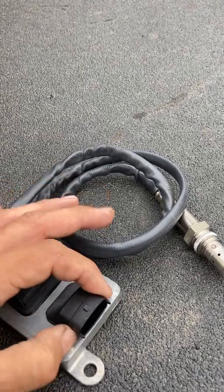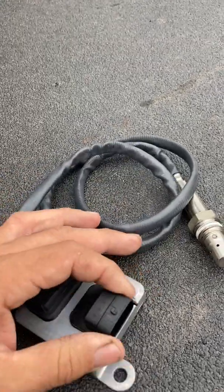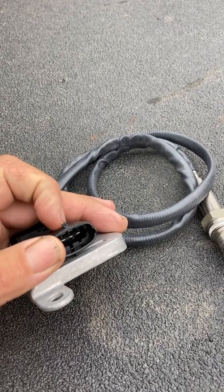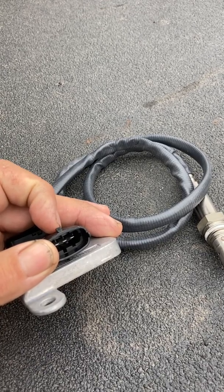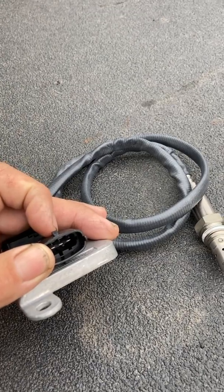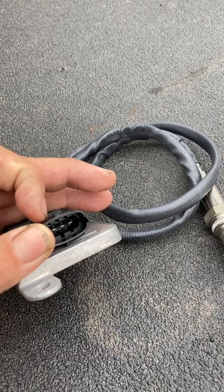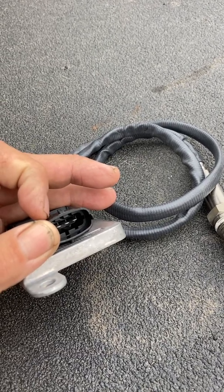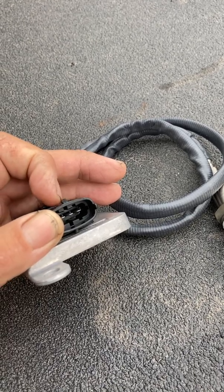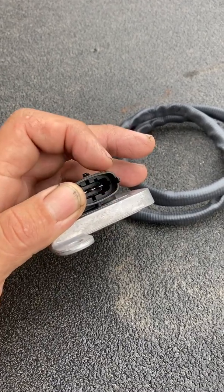This is a smart device, meaning you're going to have battery ground, battery voltage, and then two additional wires — one will be north of 2.5 volts and the other will be south of 2.5 volts. If you unplug the device, you should see 12-volt battery system voltage, and that other signal voltage. It has to be plugged in to measure, so you have to go in on the back side.